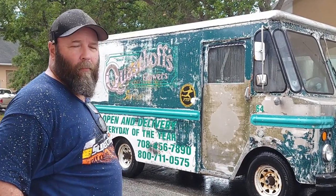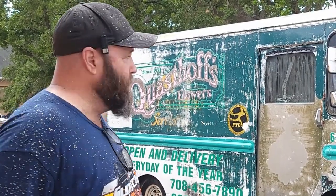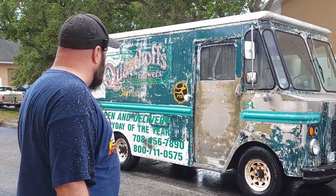So I miraculously found a master cylinder that worked, and it was actually out of a 54 pickup truck. It's a 64. No matter where I looked, nothing was ever right. I started looking back further and further because I started finding other stuff that was from a 50 Chevy. Lo and behold, found one, changed it, replaced the hoses and brake lines, ran new fuel line.